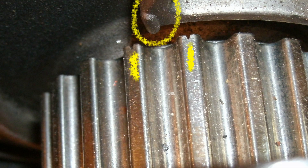What I normally do is remove everything until I get the cam cover off. If it has VVT hubs and the screws going through the cam sprockets are sticking out over the cam cover, there are normally three screws — I'll back one or two of them out and leave one tight so the cam cover will clear them. Once the cam cover is off and the cams are loose or removed, I set the crank on the mark — the sprocket mark that aligns with a nipple on the oil pump.